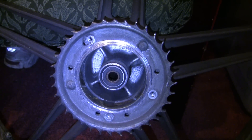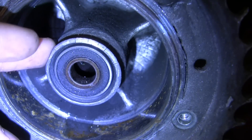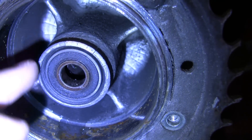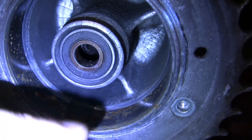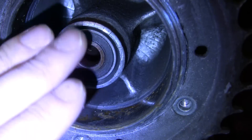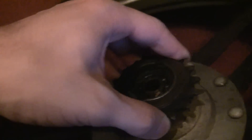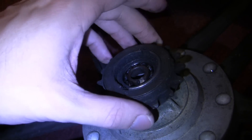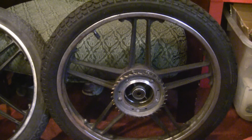Not a huge deal — you just replace the sprocket and run a properly tightened chain. Here's the bearing seat, and what concerns me are all these cracks in it along here. This is not good. Also, when I pulled the axle out — this is a sealed bearing axle — this one plopped out the first time, which is unnerving considering I had to install it with a hammer before. That alone is enough to make me want to pitch this wheel. And something else that happened: the freewheel locked up on me for the pedal chain, so my pedals just started going thunk, thunk, thunk as my feet tried to stay on them. I consider the wheel on the right ready to be mounted on the wall for the trophy that it is.